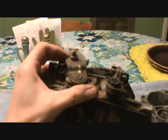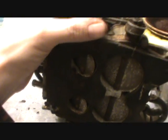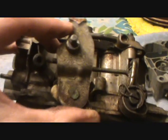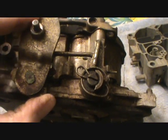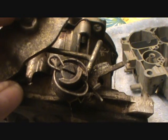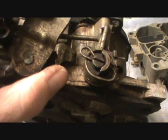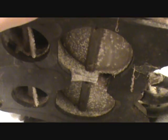Alright, now of course your throttle cable is attached here and it rotates back like this. You can see when you open the accelerator it opens the primaries, and then you have the rod going back here. Watch this rod - it's trying to kick open the secondary barrel. See how far this is coming back. Pay very close attention when I do this again - watch the end of this shaft, that screw head there. That's the end of the throttle shaft, that's what the flaps are mounted on.